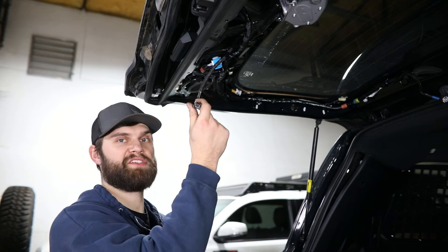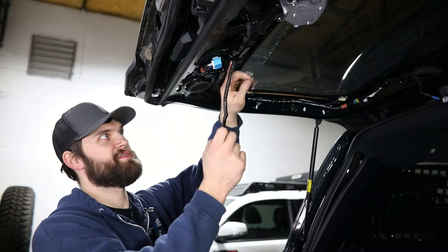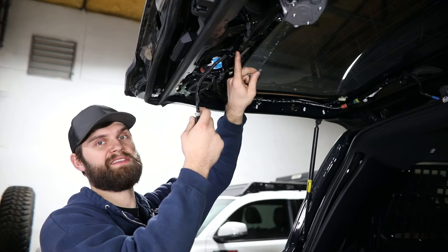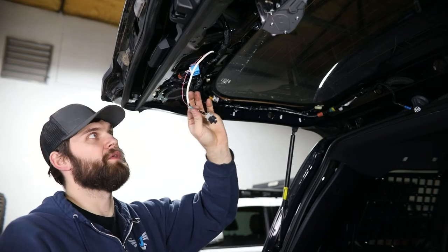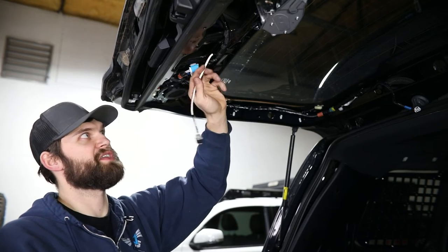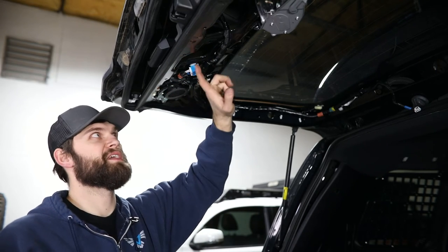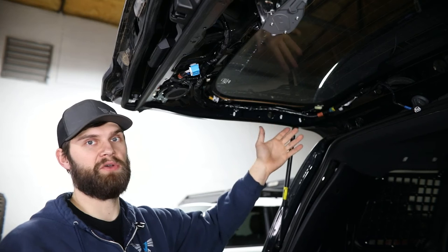Next, we're going to need to pull this harness connection from the vehicle so that it can be used on the carrier. For this, we're just going to need to cut these few sections of tape and pull back this loom so that we can expose the wire behind here. You're just going to be pulling this back basically right to here where it tees in with the next section of wiring harness. Once this is all exposed, you're going to cut this back here as close to this harness section as possible. You won't need to worry about covering up these ends because as soon as we cut these up here at the body, those are just going to be dead wires running inside of that loom, not doing anything.